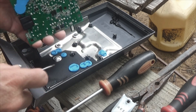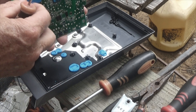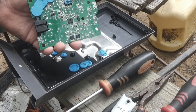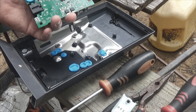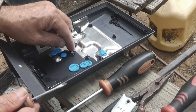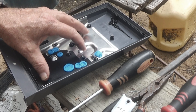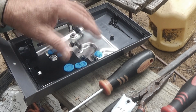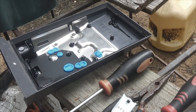This blue that you see on here and down inside here may be heat sink glue — I'm not really sure. Underneath here you've got more pieces. I took this off yesterday and did not see anything that was definitely damaged, but this unit has been knocked out and no longer works from lightning. If you remove this piece and this one, the unit is completely disassembled and there's no components behind this. I think this is part of the Faraday cage, which keeps spurious RF from leaking out — again, this is conjecture on my part.